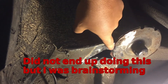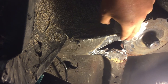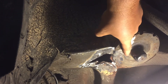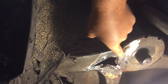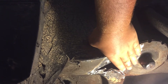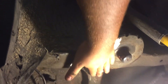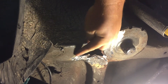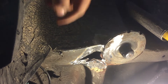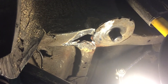I'm going to cut a slit here and a slit over there and cut basically a square out of this plate. And then the plate I'm going to weld over this whole hole will fit into that. So there will be a little square cutout that fits over onto this nice thick spring perch. Then it will come over, go over to this one and it will be welded right on this bend over here. Probably with 3/16 steel or some real thick steel like that, where it's just kind of probably overkill.